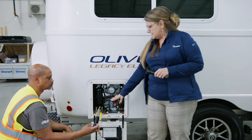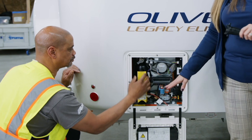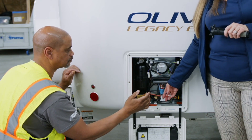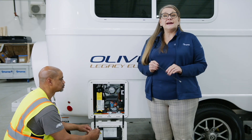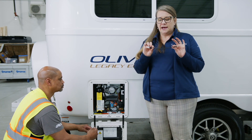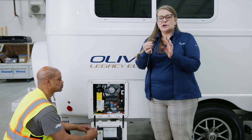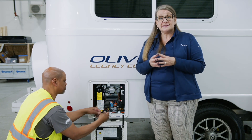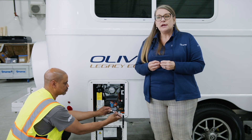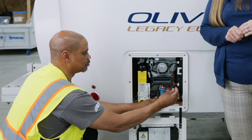Then go ahead and insert the electric antifreeze kit into the Aquago. Make sure the cord doesn't get caught or pinched — you want it positioned in the opening where the hinge pivots — then close that up. Next, insert the pigtail adapter into the circuit board. It goes into the 20-pin harness on pins 1 and 11. For a clearer illustration, refer to the installation manual that comes with the antifreeze kit.